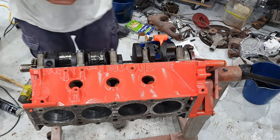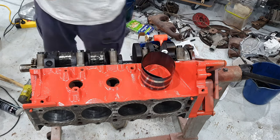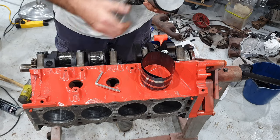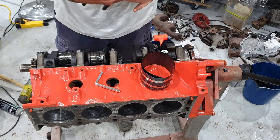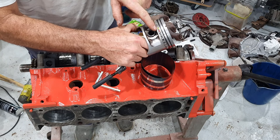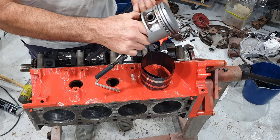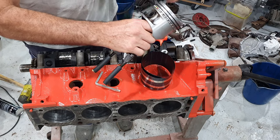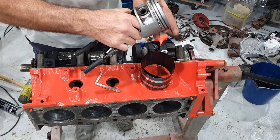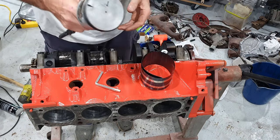What we've got here is a piston ring compressor. This one here, you just pop a little clip and it opens up. It has a little square drive thing for tightening up the clamp and compressing the rings. Like I showed you before, in this piston you can see that green and red little block there. That way I know that the oil ring separator has not doubled over itself. Pretty simple process. And I have separated the oil ring groove bottom ones around the back here and the other ones opposite side there. And I have the compression ring here near this land, and I have the scraper ring or the second ring next to this land. So they're all opposing, for good compression.